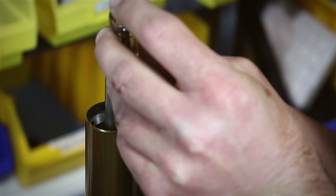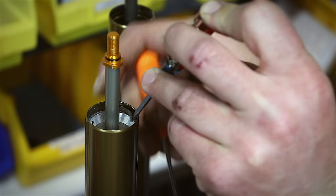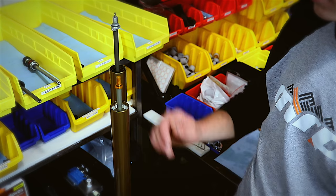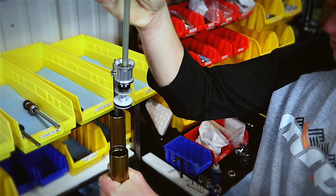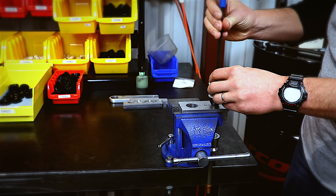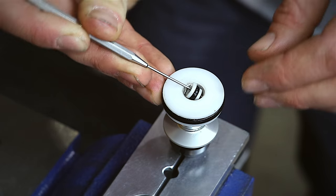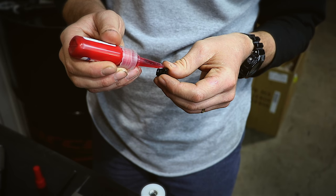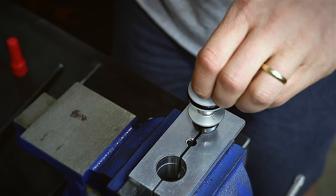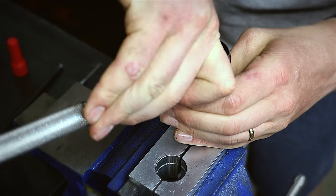Using a pick and a flat head screwdriver, remove the spring retaining ring from the bottom inside of the spring side stanchion. Pull the air shaft to remove the spring assembly from the stanchion. Clamp the spring assembly in a vise using 10 millimeter soft jaws. Remove the piston bolt, then remove the transfer shaft bushing and seal as well. Apply Loctite to its threads — do not allow any Loctite to contaminate the o-ring. Install the bolt and torque to 50 inch pounds or 5.7 newton meters.